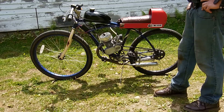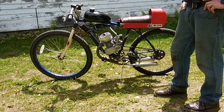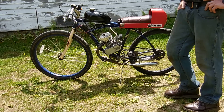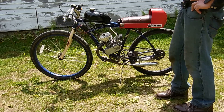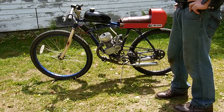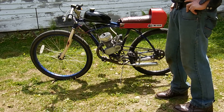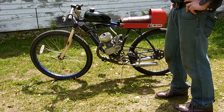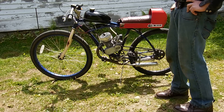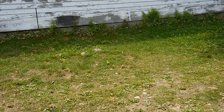Frankly, traveling over 45 miles an hour all the time can be dangerous, as we now know. This engine will be available with a few different cylinder head sizes. This particular one is fitted with the 5cc head, and after extended full-throttle operation, upon removing the cylinder head and looking at the piston, the piston was nice and clean — so that's good. Let's start it up.